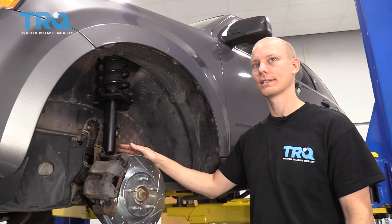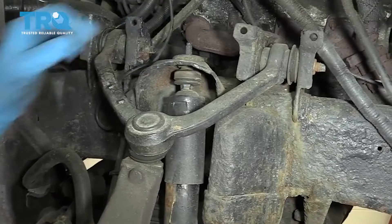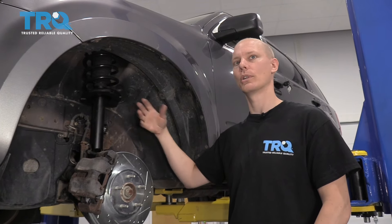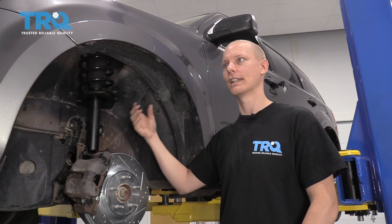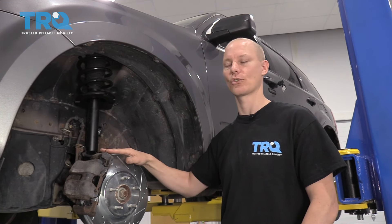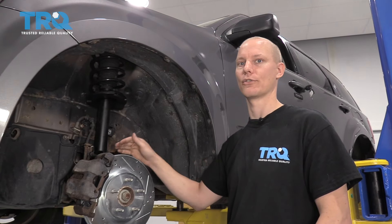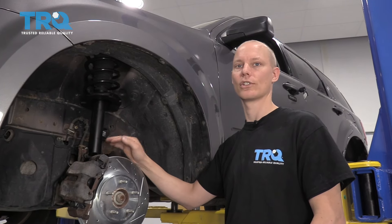If you have a vehicle with front shocks instead of struts, a shock is usually pretty easy to remove. Usually there's one bolt on the top and then two bolts on the bottom. You should be able to pull the shock out and it won't really affect the structure of the vehicle, as opposed to a McPherson strut where you'd pull out the strut and the whole front end kind of falls apart. The shock is an individual unit that can be removed from the car and the car will still stay together — the wheel still stays straight. You can pull the shock right out of the bottom of the control arm or wherever it happens to mount. Shocks are generally really easy to install, so it's totally a do-it-yourself driveway repair.